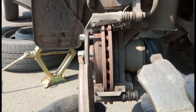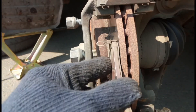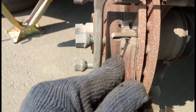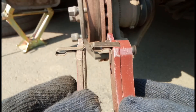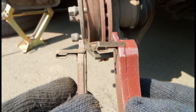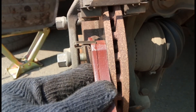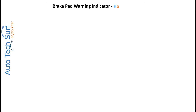This metal clip is our today's focus point — it is nothing but the pad wear warning indicator. The outer brake pad does not have any pad wear warning indicator. My car was squealing whenever brakes were applied because the brake pads were about to wear out and the wear indicators started touching the brake disc. For comparison, you can see the new and old brake pads — the warning indicator position is close or away depending on friction material thickness.